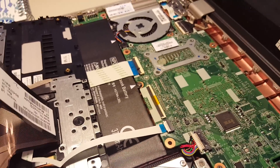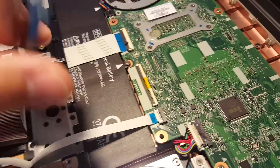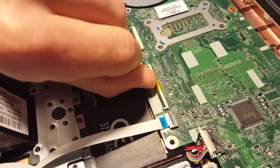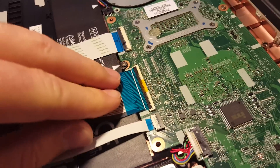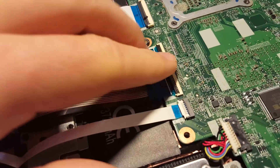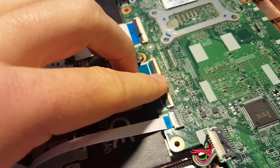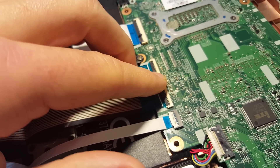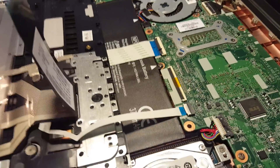Things I've tried so far — not much, but I've tried tape. I've tried sliding the cable in, kind of clamping it down, and then taping it down onto the motherboard. I powered it up and had no success with that.